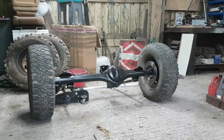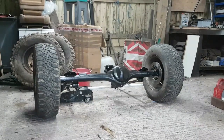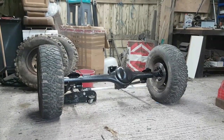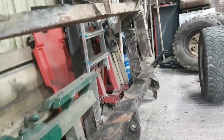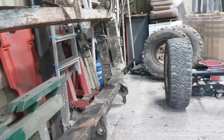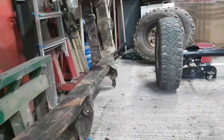And it just makes it a little bit firmer and so forth. And as this thing's going to be a little bit tricked up, not a lot tricked up, I'm not going absolutely berserk with it, but I haven't got the original engine, haven't got the original gearbox to it. It'll have a long stick LT95 gearbox, as I've said already. That will fit straight in there. But I want to get the whole chassis built up with all its running gear before I start messing around with the bulkhead and so forth.